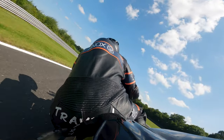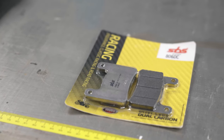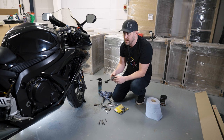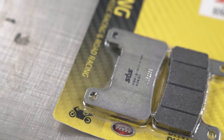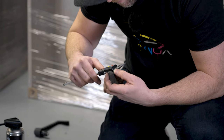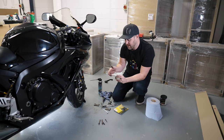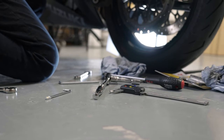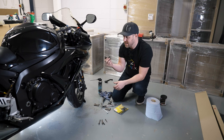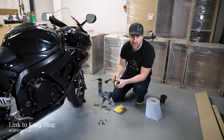So what am I replacing them with? These are a slightly upgraded pad — the 806, same size, but dual carbon instead. While the race-sintered pads are designed for racing, these dual carbons are the next level up. If you read on their website, these are more orientated towards managing high temperatures. I'm also hoping that by using these, they're going to reduce temperatures and stop my fluid boiling up. I'll put them in and see how we get on — you'll probably see them mentioned in a future video or I'll do a blog about them.